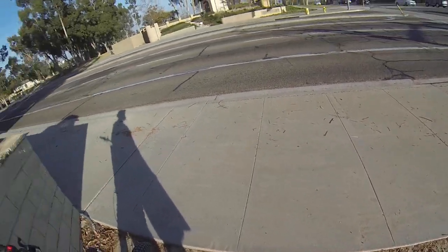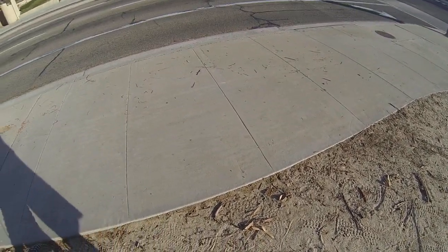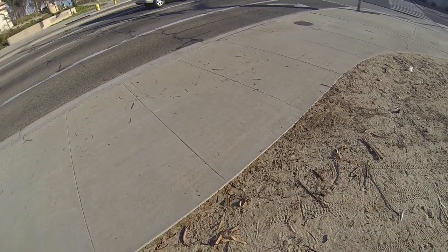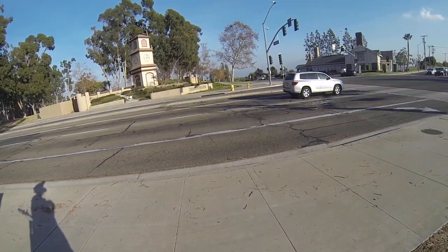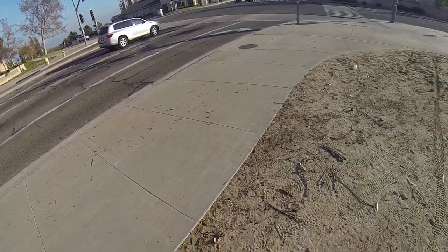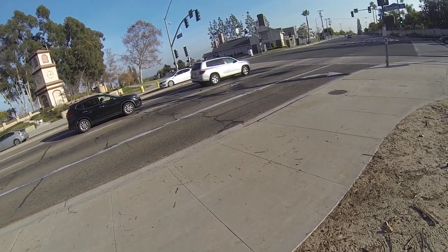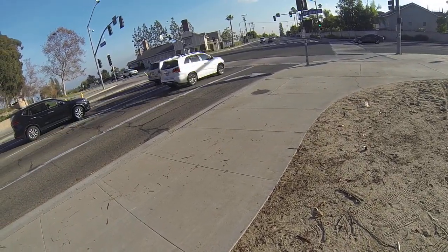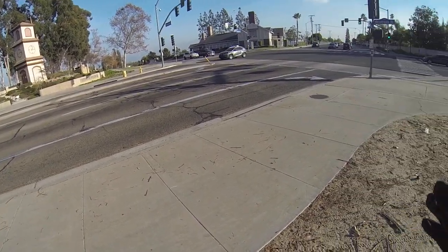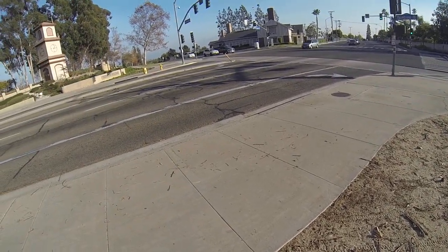Hopefully this experience can help you guys decide on how you want to set it up. Again, like on my older videos, this is really a dirt bike motorcycle, and me attempting to get into that bicycle zone just helps me understand that it is really a motorcycle, and it's just better to keep it at that 60 volt power. I still think the 60T sprocket is great for what I do. I don't ride with anyone, so I don't need to keep up with any other type of bikes. Having those chain and sprocket options is great, and it's very customizable for what you want to do, but pretending it's a bike and riding 45 miles an hour, that's kind of ridiculous, and dangerous as well.